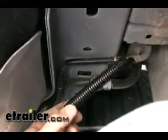You'll notice with the installation kit there's a piece of loom provided, and this piece of loom is intended to go over the AC line right here. That's going to give us a little bit of additional protection when we go to put the hitch up in position. I'm going to go ahead and put that on now before we attempt to put the hitch up into place. The forward side of the hitch is most likely going to slide underneath the AC line, so you definitely want to take care when putting it up into place.